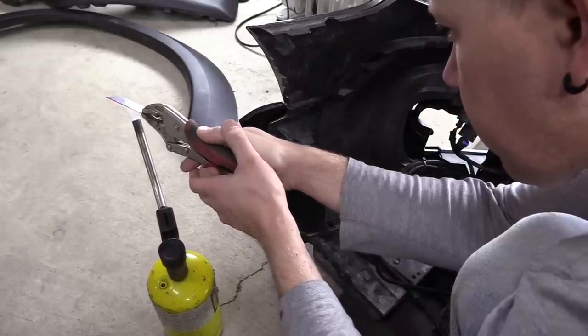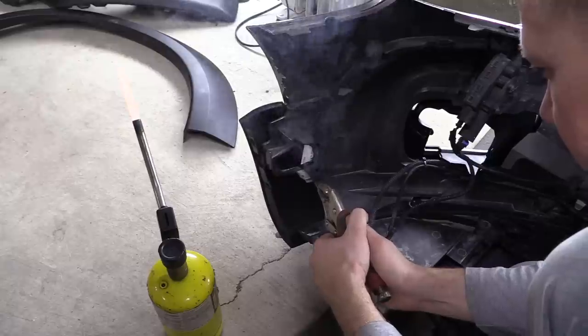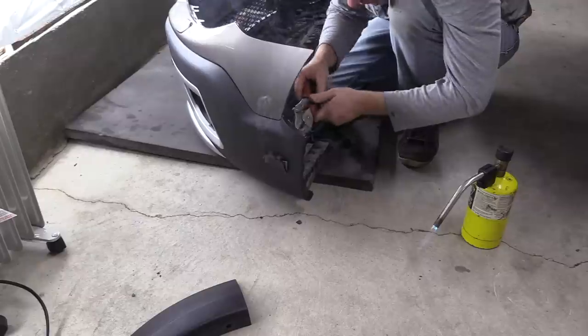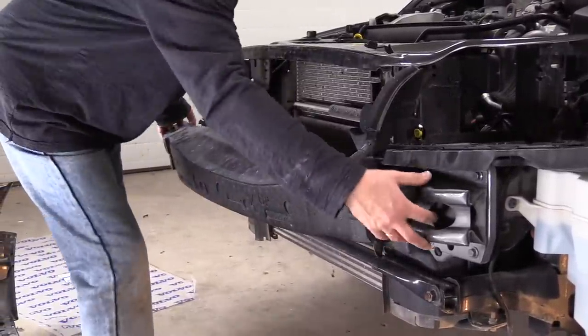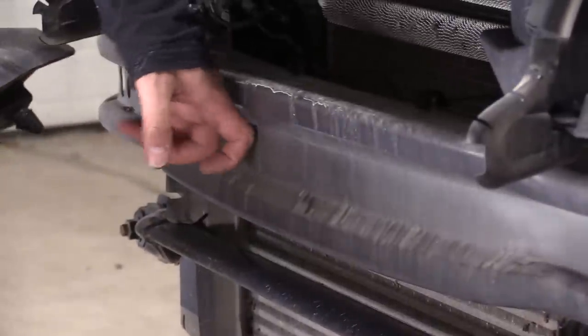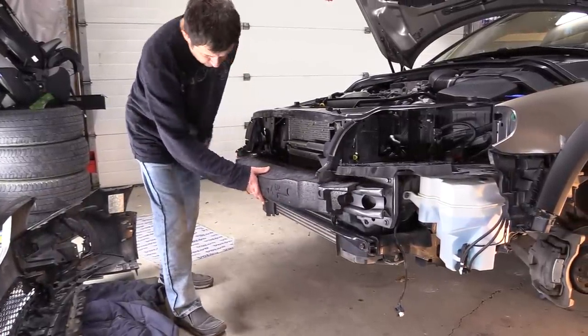Before installing the bumper cover, we need to cut out the opening for the block heater because we've installed the new part. I'll put a link in the description on how I did the block heater installation, which heats the coolant during winter to make the car easier to start and get quicker heat in the cabin. I'm using a knife and a torch to cut out the opening. Almost done. I'll also show you the reinforcement here — this is a solid, light piece that we'll drill through to install the bracket for the auxiliary lights. I'll include this clip in the next video.